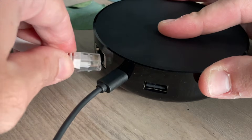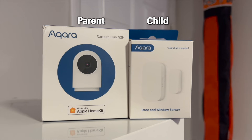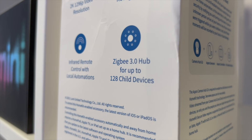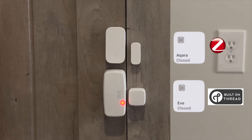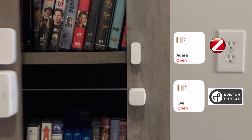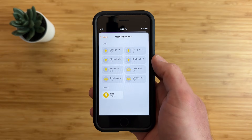The third connection type is Zigbee, and this is often used in devices that require a bridge. The bridge connects to your home internet over Wi-Fi or Ethernet, and the specific devices connect to the bridge. Well-known brands like Aqara and Philips Hue use Zigbee. Devices that require a hub are often more reliable than Wi-Fi-only connected devices, since they don't have to compete for a signal with your other wireless devices and connect directly to their respective bridge.